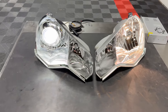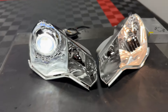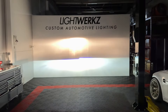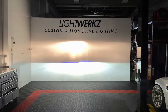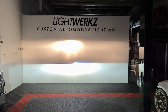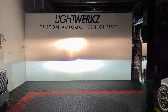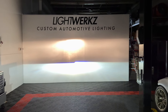We'll be comparing these two with a factory 35-watt ballast on the retrofitted one, and this is the halogen lit up as the original light source. Obviously we've got the halogen light source on top and the retrofitted G5 BRT on the bottom. The camera picks it up really nicely because it's showing the hotspot intensity zones — how tall it is, how wide it is. The first biggest thing you notice before I even touch the exposure on this camera phone is the width. You're gaining a ton of width with the retrofitted setup.